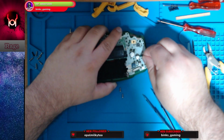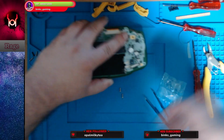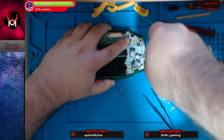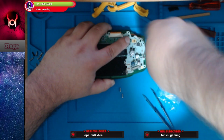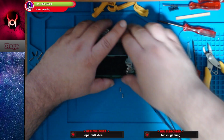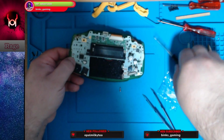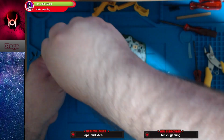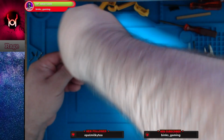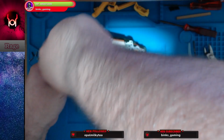Right, doesn't matter. Let's do this. First time screwing in, so they're going to be not loose. You're going to have to work your way in because you're initially creating the threads. With most metal into plastic, you don't want to go all the way in. I tend to go in a bit, get it seated, and then press in, and then quarter turn back. It sounds complex. It's not. It's just about being gentle, careful, and then obviously checking the front to make sure you didn't crack anything.